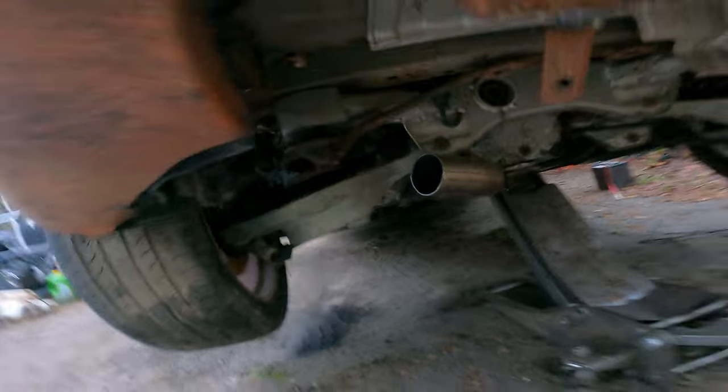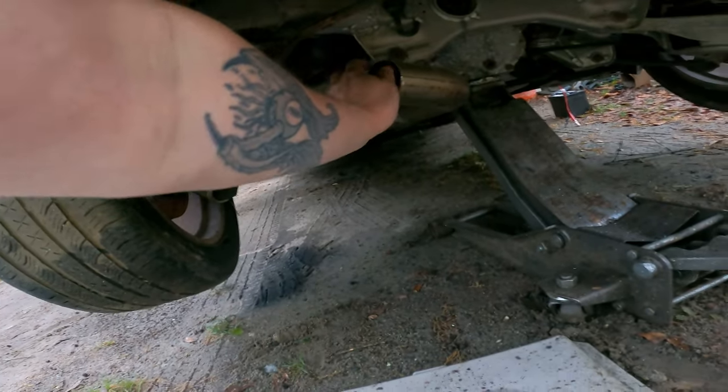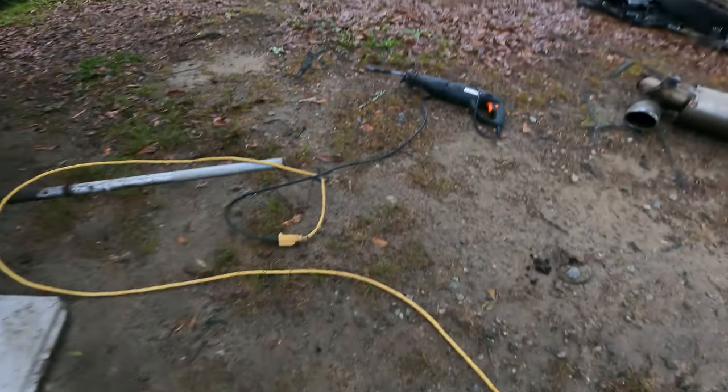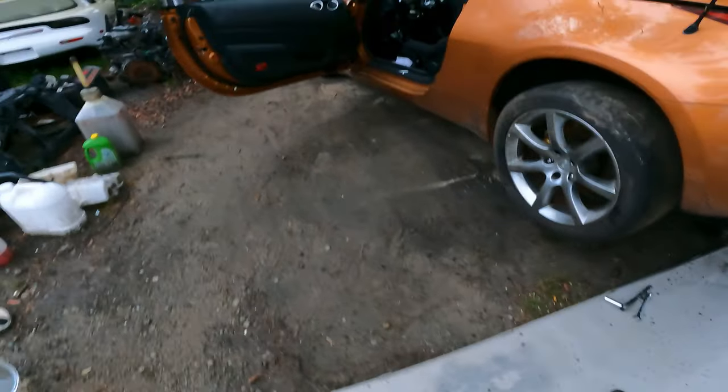It just cut it right there. But look at the difference. I mean, you can actually see stuff moving. At least kind of hope it's a difference. So let's get inside and rev this thing and see if it made an improvement. I'm guessing the converter blew and got clogged up in there. You saw that shoot out. I can hear stuff still flying out of it.